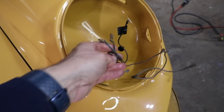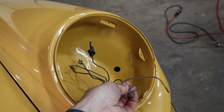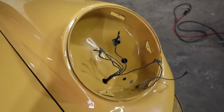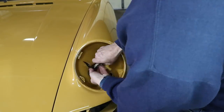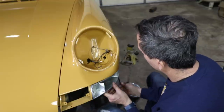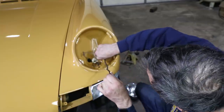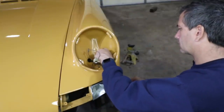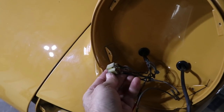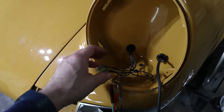Not bad. Now, I said this before when I was going through some of my wire harness stuff — these turn signal wires are okay, but the headlight wires are not okay. This is the ground wire and it's just overheated. It's burned insulation, so it's not safe to connect the headlights. But I'm going to install them anyway — I'm going to have to rebuild the headlight harness. All the fuses and wiring are not connected for the headlights.